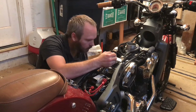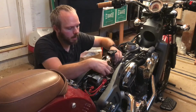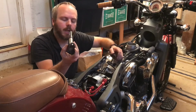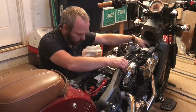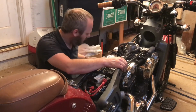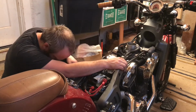Okay. Now, rear coil plug. See, the wiring would be hanging it up right now if I hadn't unplugged it. This is your coil pack. Deep down in that hole is the spark plug. I'll remove the other coil pack. Yes, it did need to go into this cavity to come out. Set it aside. Don't let anything crawl up or fall inside of them.